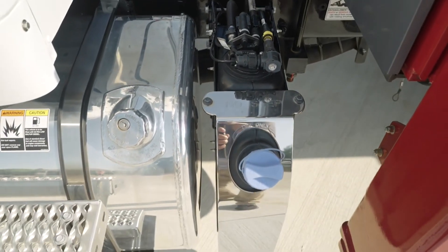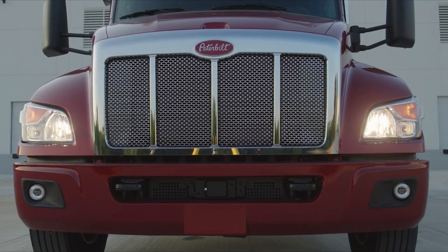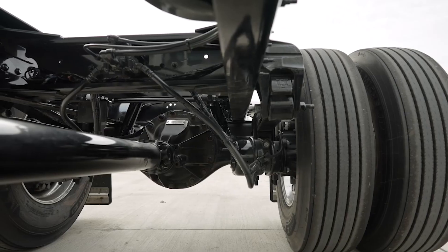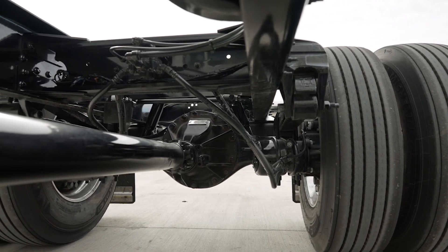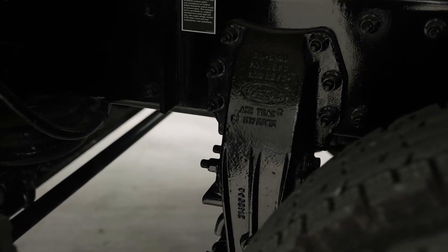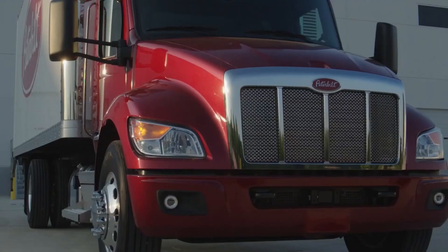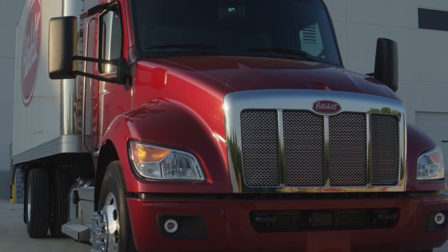Check frame-mounted fuel and DEF tanks for leaks and damage. Make sure none of the exterior lights have any cracks or blockages. Check wheel mounts and retighten if necessary. Check suspension components for loose or missing fasteners, and check for damage to springs or other suspension parts such as cracks, gouges, distortions, bulges, or chafing. Check all service and parking brakes and make sure they're in working order. Check all brake lines for damage and corrosion. Check all trailer connections and make sure the lines are secure and stored properly.